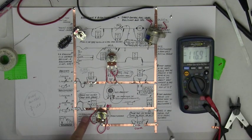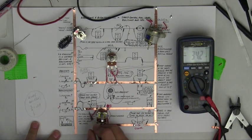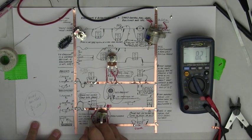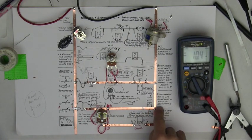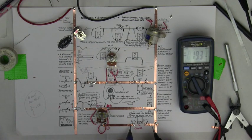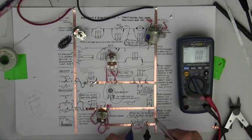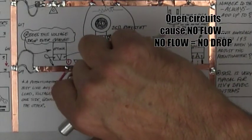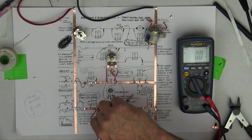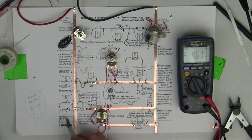So there's an open ground, and we get full voltage all the time — that's some of the fault codes you get. Now let me open the positive. When I open the positive, I've just got zero volts coming all the way through, so I'm going to read zero. Because I've got continuity all the way through here, through this device, and there's no current flow. So if my voltage never changes, obviously I have no current flow. I'm looking for current flow to make the potentiometer work. Just remember: plus in and ground out, and that's how it works. The 5K part is because we just don't want a lot of current.